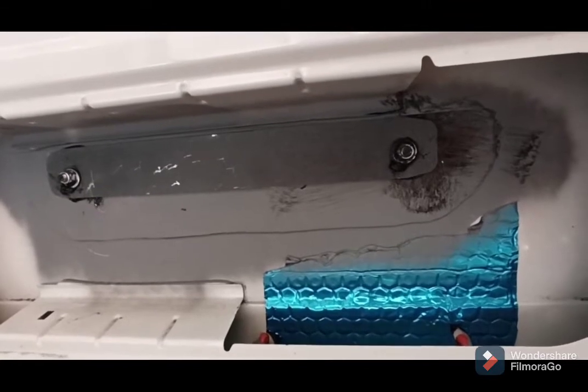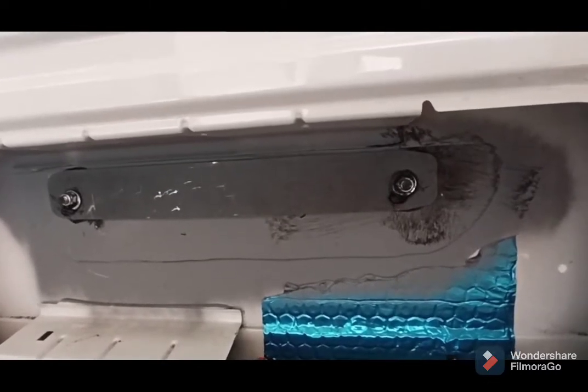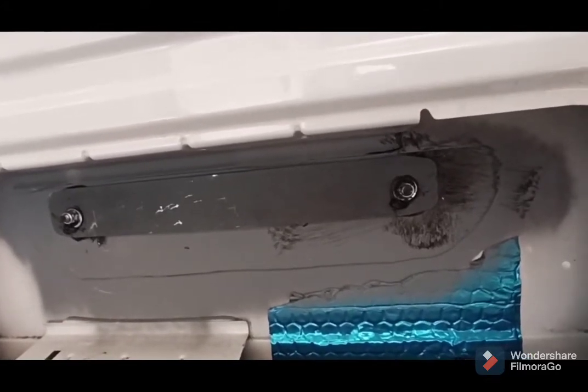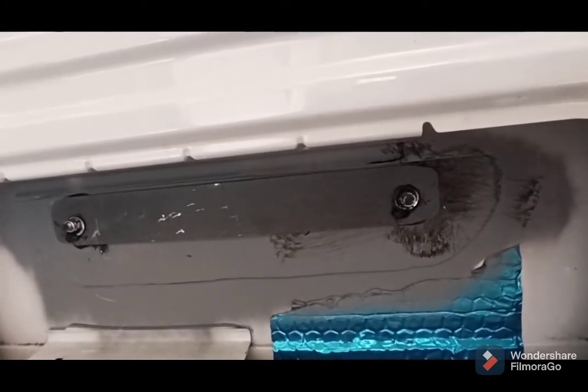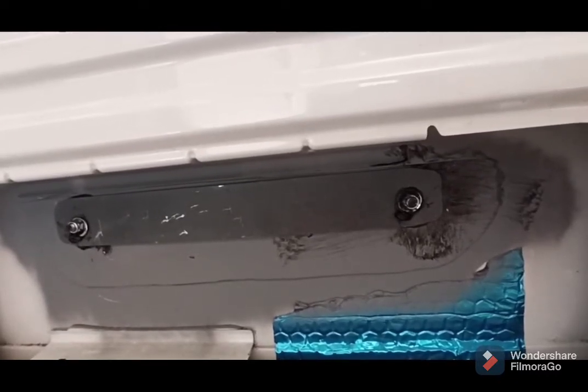Just a little guideline to the way I fitted it - what I actually did to strengthen the steel work in the back door when I bolted it on. When I fitted my windows over the back and cut the holes out the side, I still had a little piece of steel panel left. So I cut it down and bonded it in place in the back door, creating a double skin, then basically drilled holes for the roof ladder and fitted the back plate on.